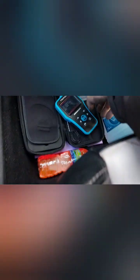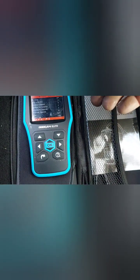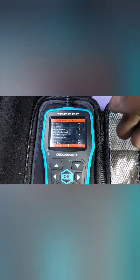See that? Yeah. Small car. Hard work. Old cable, stiff. Yeah. What does it say? Let's do diagnose. Ignition is on. All these little Peugeots, you have to have ignition on. Right, it says that MIL status is off. It's got one DTC. Let's read the codes.